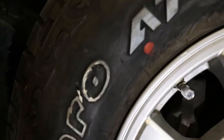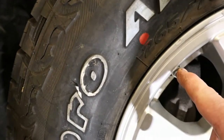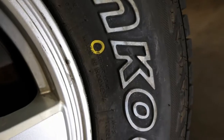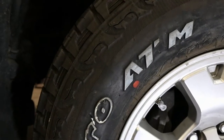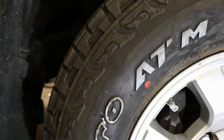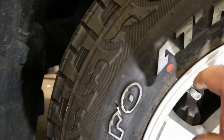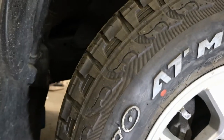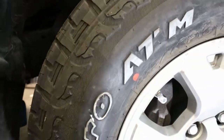The red dot on the outside of your tire, when your tire is put on, that red dot should line up with the valve stem. If there's no red dot and there's only a yellow dot, then the yellow dot will be lined up with the valve stem. They design these tires as best they can, however they do pre-balance them at the factory and there's actually a high spot in one area of the tire. They place this dot in an area where it should be lined up with the valve stem.